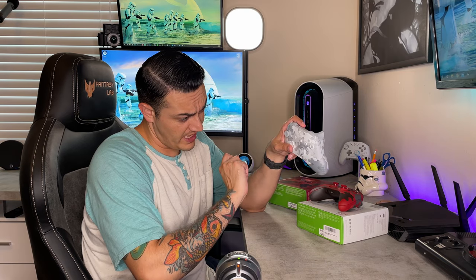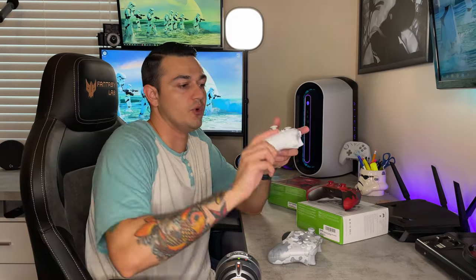During my initial disassembly of the Arctic Frosty — or Whiteout as I like to call it — Series S controller, I noted that there are different bumpers, and they are a lot more durable and less likely to break, as that was a common point of failure on the original Xbox One controller. Face buttons are virtually identical, almost — they're actually a couple of millimeters higher. I used Xbox One face buttons on this build, but they're sunken into the shell and it is definitely noticeable. So make sure when you're purchasing components for a build that you get Xbox Series buttons.